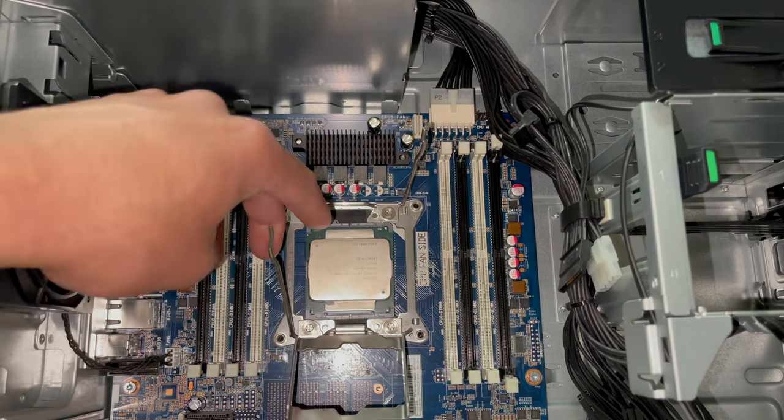So, all right, we're back in the installer now. It shouldn't matter what port you have any USB drives in. I have mine in the front, but I have all my USB ports injected with the USBInjectAll kernel extension, so we should be good to go. So let's go ahead and head into Disk Utility.